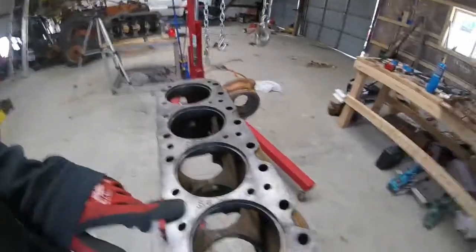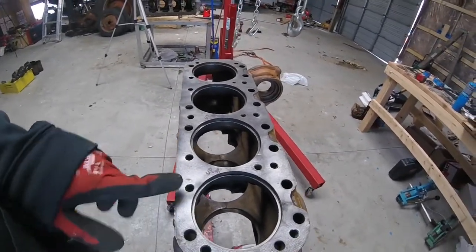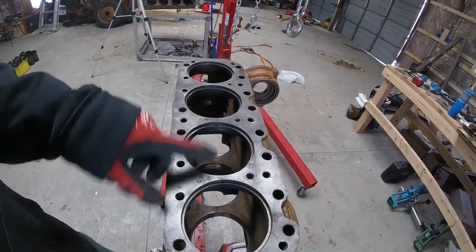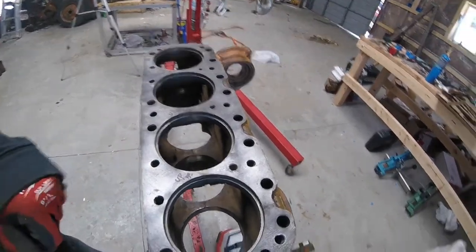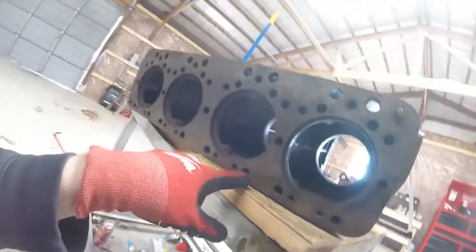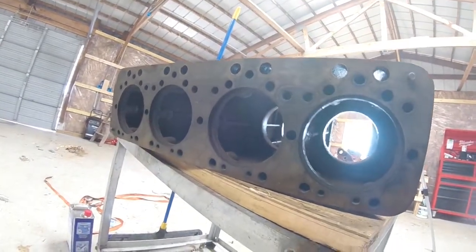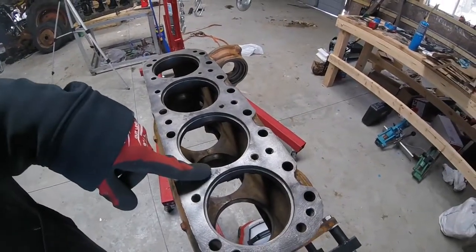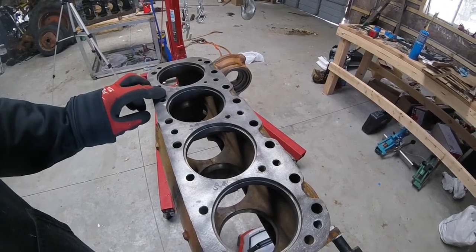The problem I see here is if I just go and put the head gasket on the block, I don't know if the cylinders are going to get pushed all the way down by the head and the head gasket and seal it off. And if it doesn't seal off, that gives us a problem because we have coolant passages all over the deck. The bigger problem is where the deck is pushing up on the cylinders the most is the farthest point away from any of the head bolts — unlike the head of my D2 where we get a good head bolt right in the middle of the deck. There's a lot less force on this head and no room to put those head studs or head bolts there, and if this was cracked, it'd possibly do more harm than good.